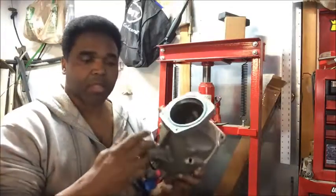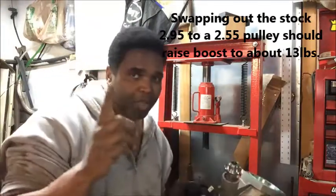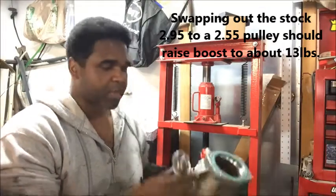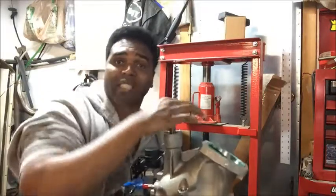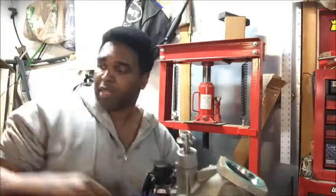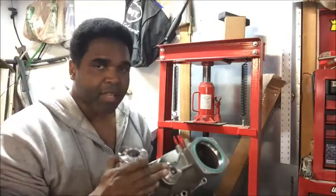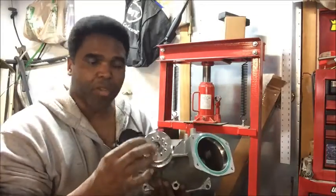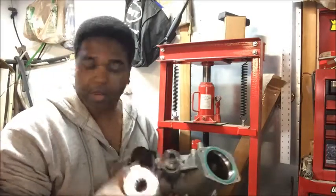Now I've got to install this hub. I got one of these hubs — I got all this from Synergy Motorsports. They give you the Lingenfelder hub — this is going to go on and it has to be pressed in, so you've got to be careful with that. Just in case later on down the road I want to change boost, it comes as a two-piece. Instead of taking the hub off like I had to do with the stock one, I just take this off — it's held on by 10 bolts — and this will allow me to change my boost. Very simple.